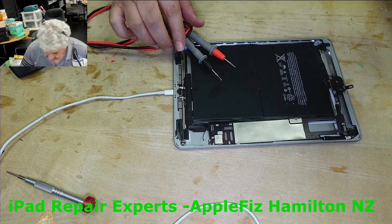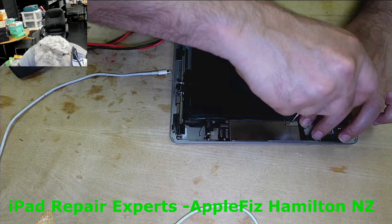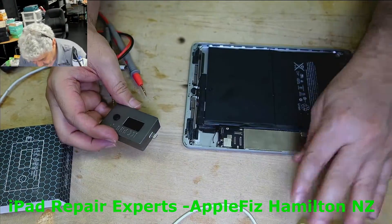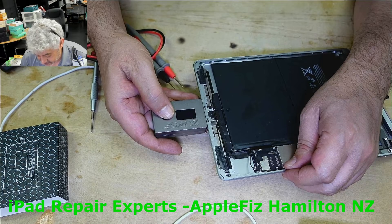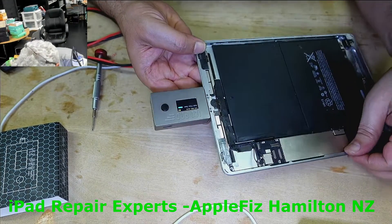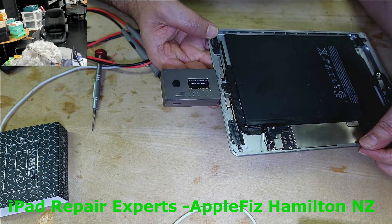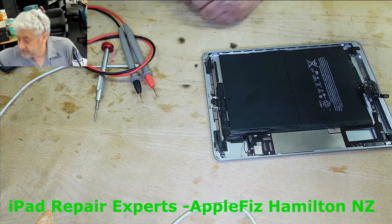The next thing is to remove this. Now I'll use iCe Pro because I don't want to replace the charging port and have it turn out to not be the charging port. Let's get some indication from iCe Pro — it's not 100% accurate, I'm just telling you, but at least let's see what we got. Dock, dock, dock — flex failed. And further it says ACCIDP1PD, so it's giving me indication of the charging port.